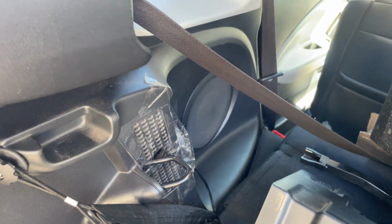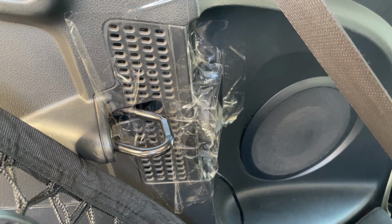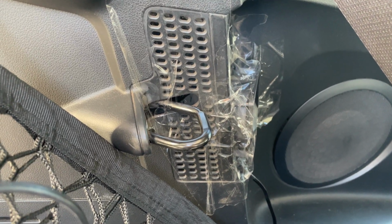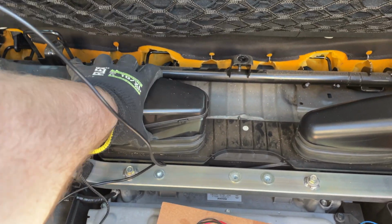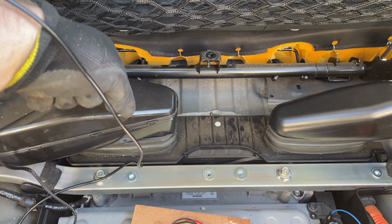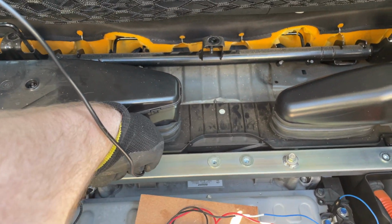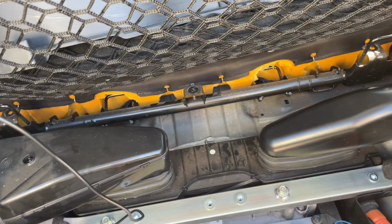Another important thing, you must always make sure that you have airflow. You need to make sure that you have a fan blowing in through the main vent, either through here, as you can see, or you take this, you pull up to unblock the vent, and you get a fan that is nice and sealed, blowing air in through there, which will circulate through the IMA pack, come out through here, through to the exhaust.